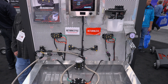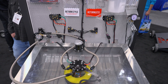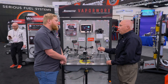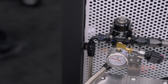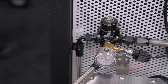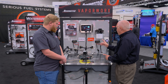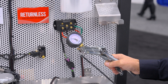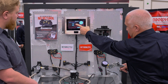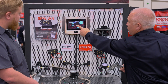We have two different systems to perform that. The first one is a true returnless system — all OEMs use a true returnless system. The way those work is with a fuel pressure sensor to provide feedback on what the fuel pressure is in the line. That's your base. And if you want to do manifold reference fuel pressure, we can do that as well. So here's your base voltage of seven and a half volts, and as you start putting more pressure into it, it's increasing voltage.